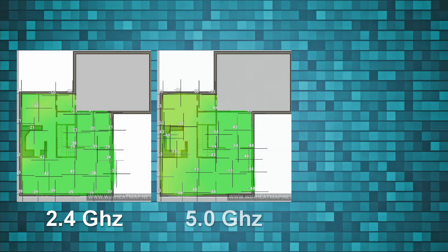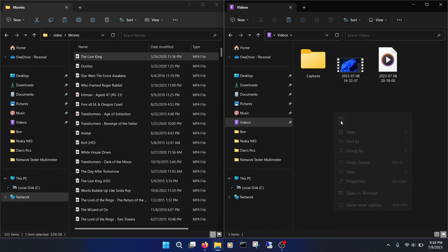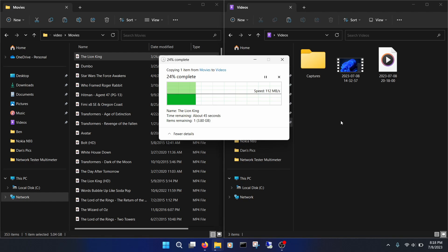As for the Wi-Fi coverage, it's great. The 2.4GHz covered the whole house, the 5GHz signal covered a bit less, and as expected, the 6GHz had a little bit less coverage, but both signals were enough to cover the house. For the speed test, I transfer a large video file from my wired gigabit NAS with platter hard drives over Wi-Fi to my Wi-Fi 5 laptop. Wi-Fi 5 is plenty fast for tests like these. I do this test sitting in the next room on my sofa, and then again in the same room as the router or access point I'm testing. Simple and repeatable.